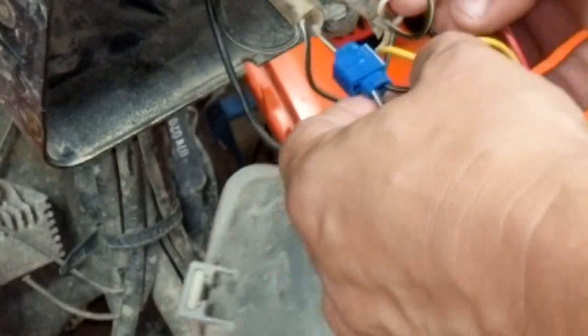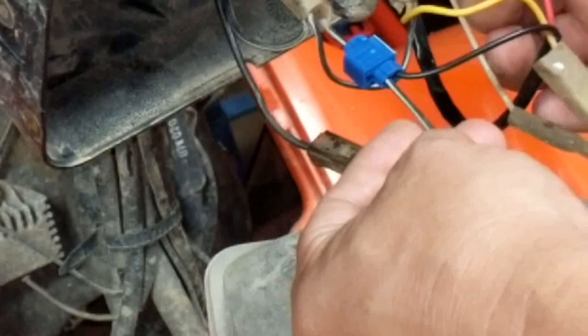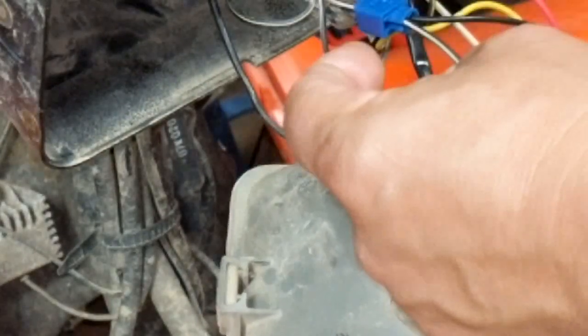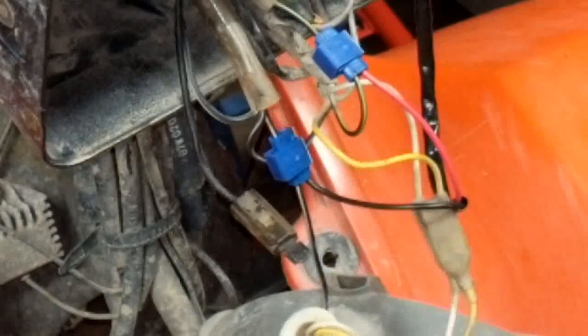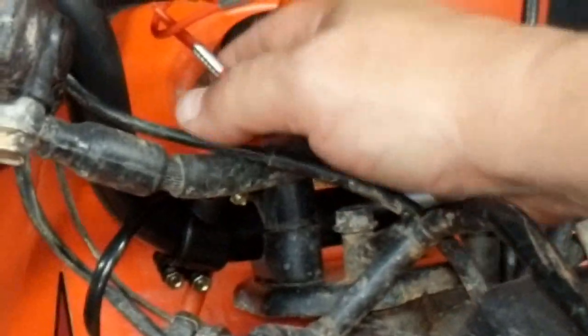So they're both connected. From looking at our wiring diagram, we've got the black with the yellow tracer and the black with the white tracer — they're the same wires that are hooked up to the original on-off switch. So we just tie in with those. When everything goes well, when we start this and pull this off, it should kill the quad. And also in the front, you have a regular push button as well.